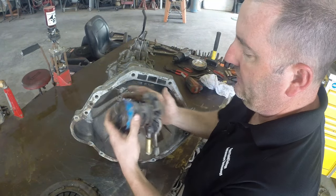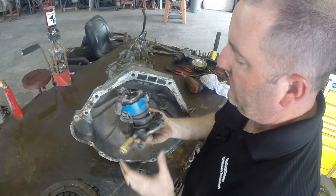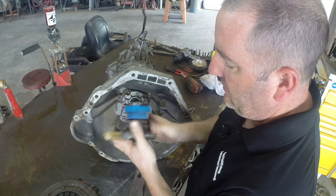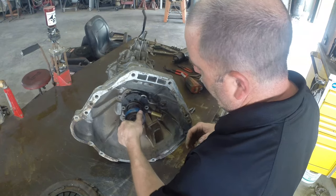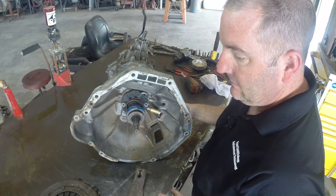That's all there is to it — a pretty simple little device. It's a hydraulic cylinder that pushes in and out on the bearing. You can replace the bearing separately on some of these, but might as well just do the whole unit and be done with it. That's a concentric slave — it lives in there on the input shaft of the transmission.